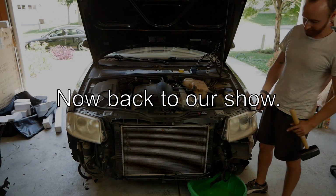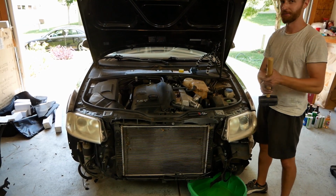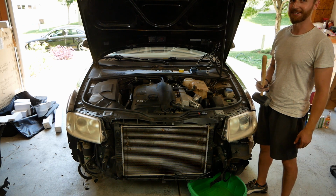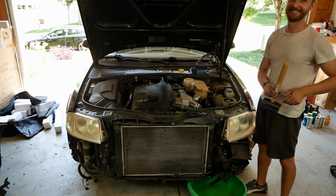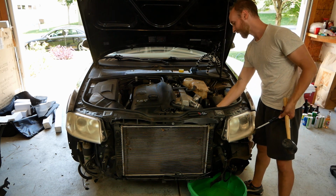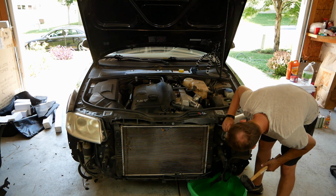We should have mentioned that when draining the fluid out of the radiator, you want to remove the radiator cap, otherwise you build up suction inside the system and it doesn't come out. Yeah, that's a footnote. That's fine. Alright, so now we're going to try to pound this hose off. It's really on there pretty good. I'm going to try not to break it.